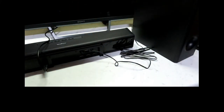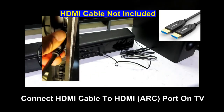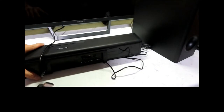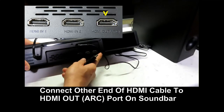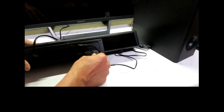With one end of the HDMI cable, plug it into the ARC port on your TV. And the other end, plug it into the HDMI port on the soundbar, labeled HDMI output ARC, right over here. Let's plug it in.